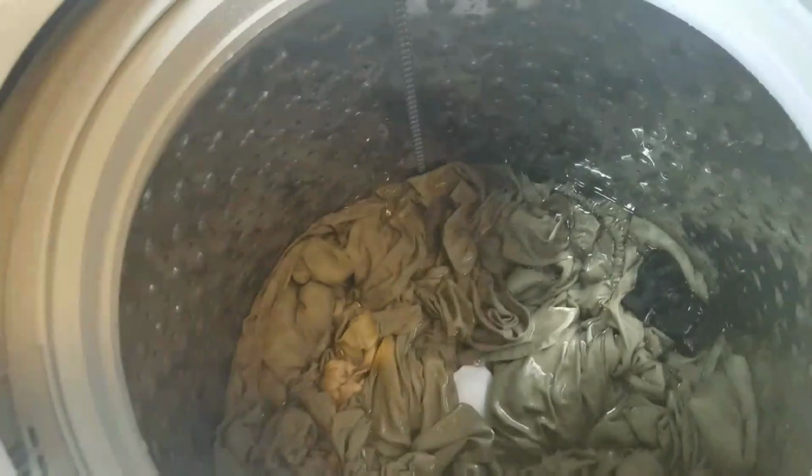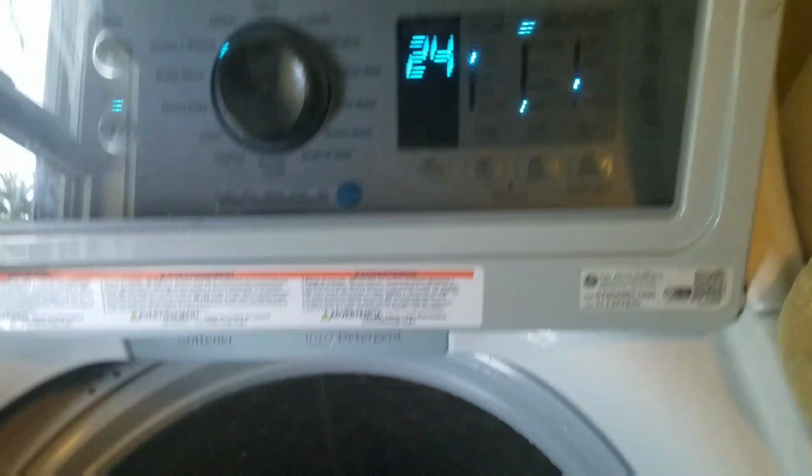I mean, one thing with age is that the sensor in here that allows for sensor automatic cycles is falling apart. It's just old. Number two, the dryer was designed with a washer that has 3.8 cubic feet of capacity. This has 4.6. So doing a full load of 4.6 gives this less room to toss all the clothes, making drying time longer. Not to mention this machine's quick cycles, you just have clothes sitting here.